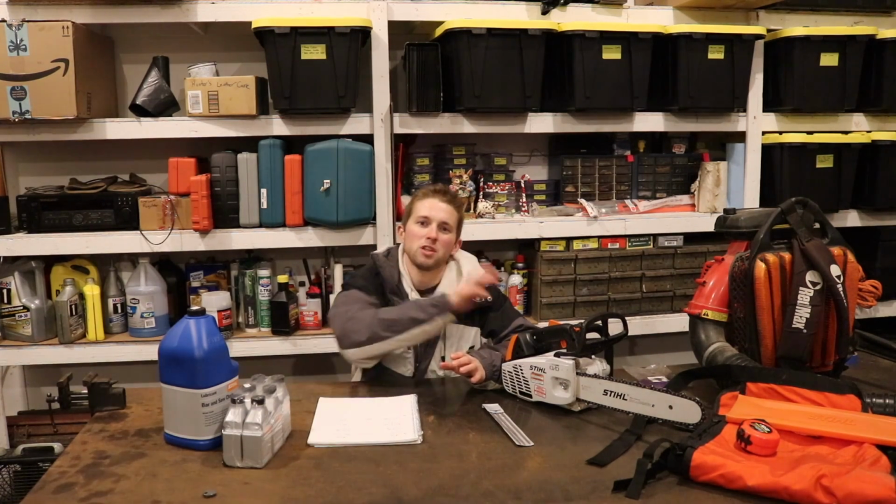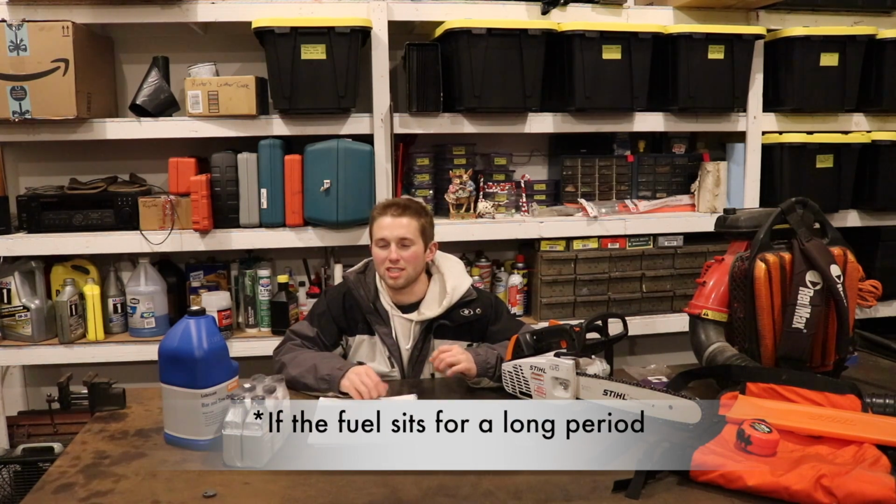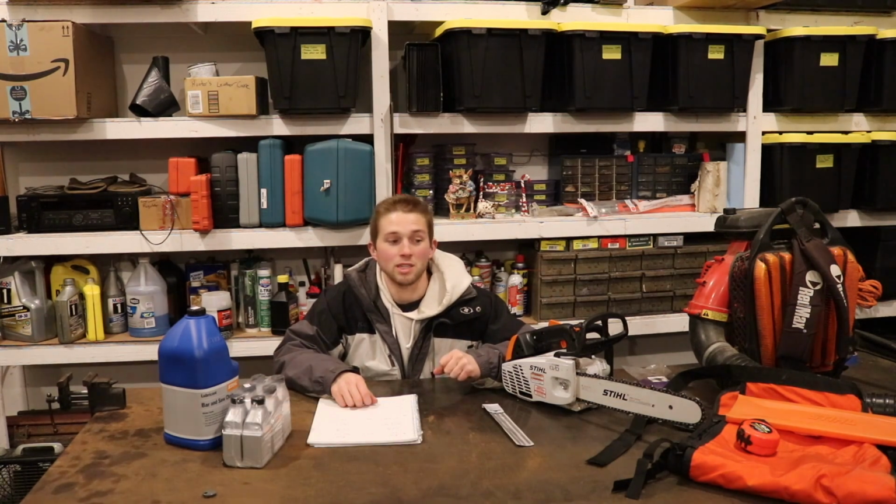Just one other small thought before closing out this video. If you don't plan to use this saw a lot, think about getting some tool fuel, which is ethanol-free gas. Ethanol is a corn-based additive that goes into gasoline, and it's known to cause damage to carburetors, so that's just something out there if you're completely green. But if you're completely green, you really shouldn't be buying a top handle chainsaw anyway.